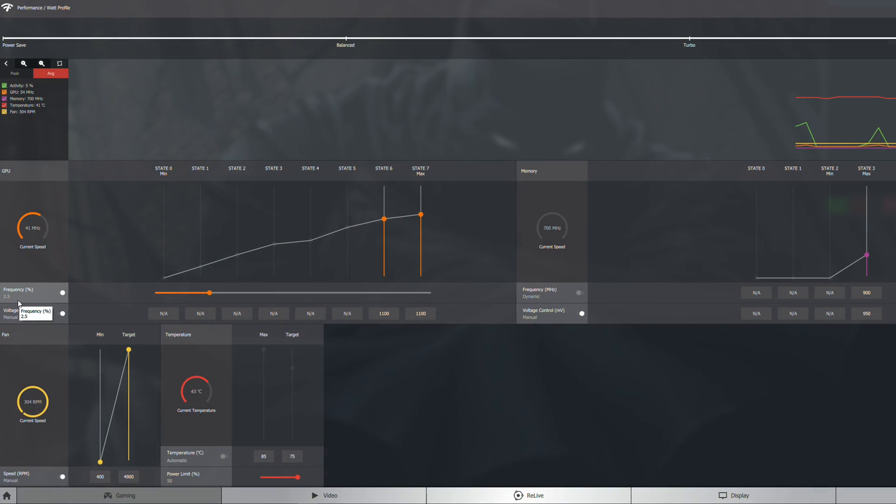I had to redo everything because I did all of my testing with the RX Vega 56 and the GTX 1070 overclocked. As far as overclocking went on RX Vega 56, I wasn't able to get a huge overclock. I was only able to put on an additional 2.5% frequency increase on the core. For the memory, which comes at 800 MHz out of the box — effectively 1600 MHz — I was able to raise that up to 900 MHz, which is effectively 1800 MHz. I was happy to get the memory up by 100 MHz and a little bit higher on the core clock as well.